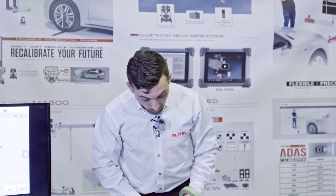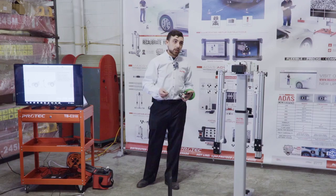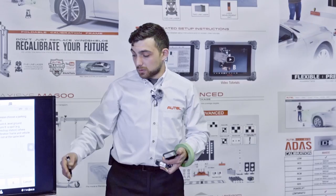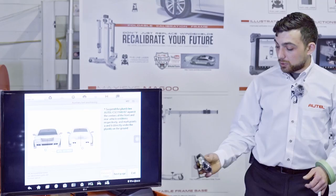The MA600 is difficult to utilize with an alignment rack because of the need to go underneath the car to get our centerline with the rack components — it's doable but takes more time. For today we're on the floor, and just like before we'll go through all the preparation requirements. Before going into the actual calibration, we select the setup button to go through all setup steps.